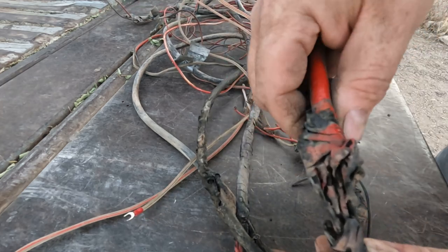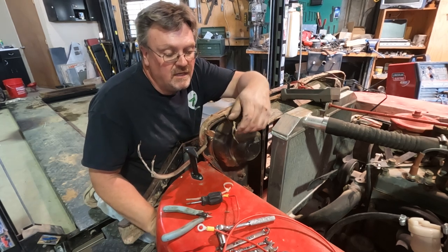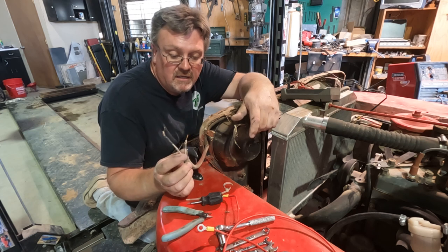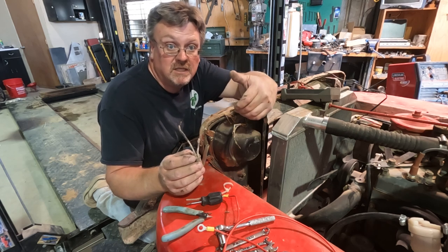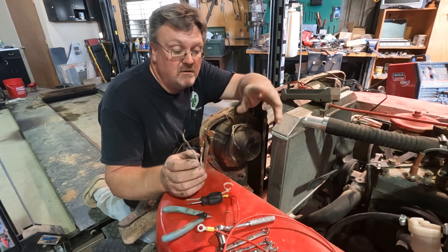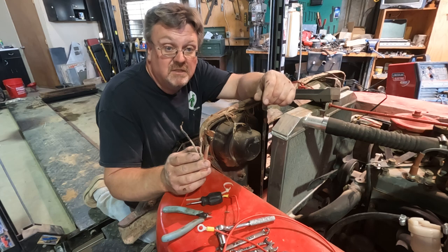There's a section that's all electrical-taped up and melted and squished and completely rigid. So that was bad. I was working on these headlights — the wire actually gets pretty decent inside some kind of loom sheath, a fabric enclosure, and that seemed to have protected it from being too bad. So I think what I'm going to do is trim these up until I get to good solid wire and use the pigtails and the connectors. That way I don't need to take the headlights out. But I do need to figure out which wires go to what — there's going to be a high and a low beam, basically two wires going to each headlight.